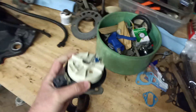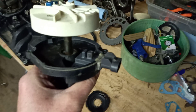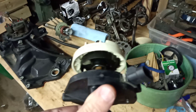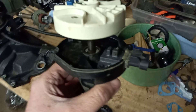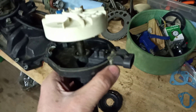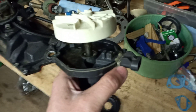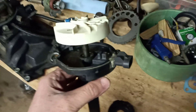As you saw in part one, the Dodge cam sensor looks almost identical to this — this is a General Motors cam sensor in a 4.3 liter V6 out of a 2002 GMC Sierra truck. You can see the similarities: there's a half-circle metal part that rotates and blocks the sensor for half a distributor revolution, and the other half it's not blocking it. So this sensor provides a resolution of basically one signal per half rotation — it's on for half a rotation and off for the other half, giving only two separate signals per full revolution.